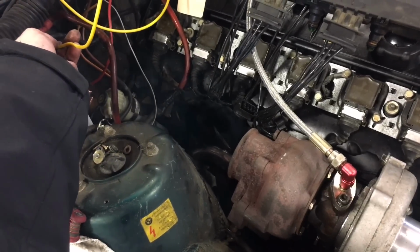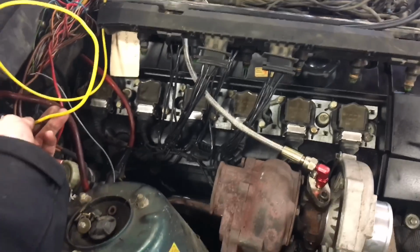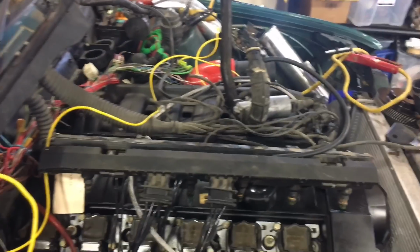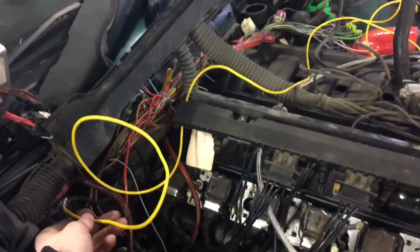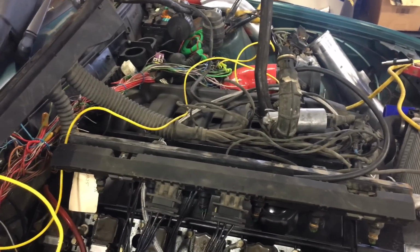There's a lot of residual gas in there apparently. I don't even have fuel injectors hooked up to the new harness. I've just got these 17-pounders sitting here, so I guess it's the harness. So I'll be ripping it down and replacing the harness. Stupid problem to have since both these came off running cars, but I guess that'll teach me to cut off the plugs I think I don't need before I even get the car running, so oops.